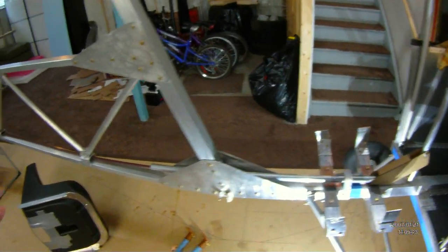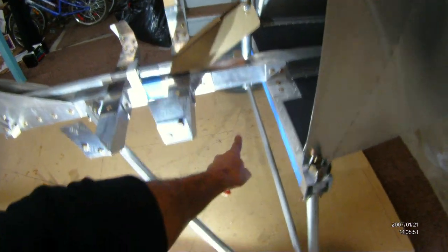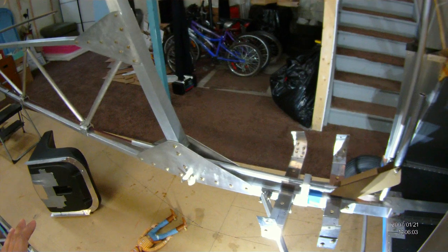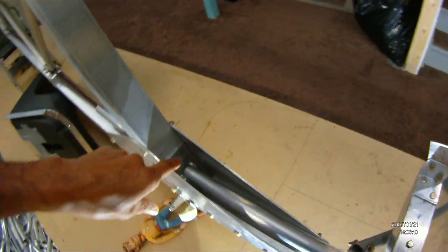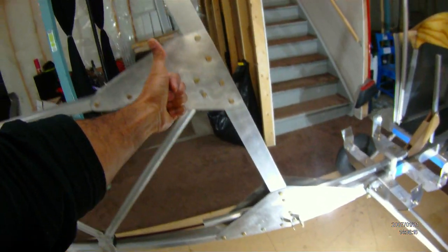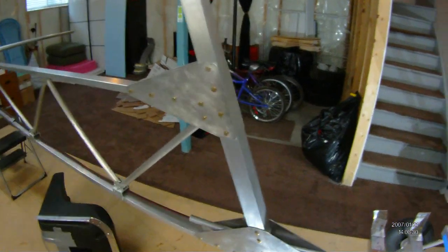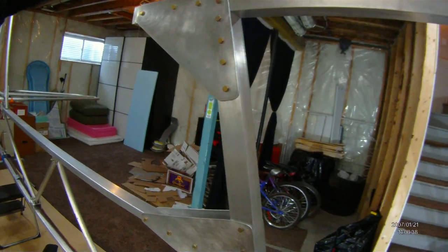Before I even started this project, there are a lot of ways to hook up your ailerons and elevators. Some people have bell cranks that come out the side and run under to more bell cranks and cables up to the ailerons — lots of different ways to skin a cat. I like these nylon-supported bearings with the one-inch tube running through. I made a hole in the fuselage for it, and it's going to have an aileron bell crank with pushrods going straight up to the control horns on the ailerons. I'm of the keep-it-simple, stupid philosophy — that was a lot easier than bell cranks, pulleys, wires, and cables.